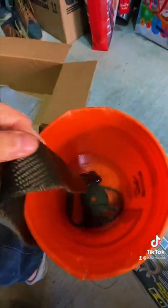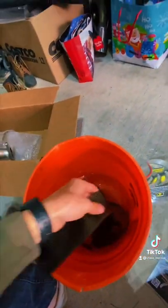The very first thing that you want to make sure you're doing is soaking your exhaust wrap. This is really important because it's going to help create a really tight wrap. And then clamps — these plumbing clamps are golden. Do not use metal zip ties, normal zip ties, or wire. That is all garbage. Use this; spend a couple extra bucks and get the right stuff.